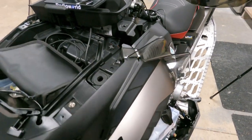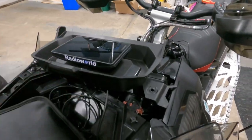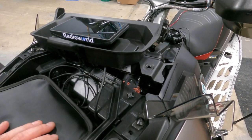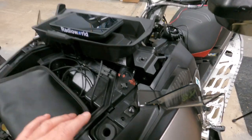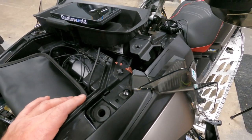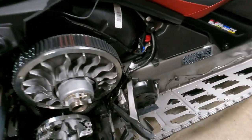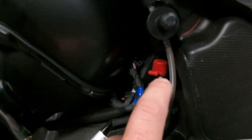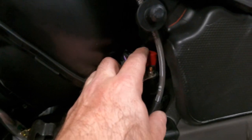There are lots of different ways to wire up a GPS, but the way we like to do it is to run it so that we don't need to turn the machine on in order to get power to the unit. One of the best ways — if not the easiest and closest — to tap power is to come down to the solenoid.